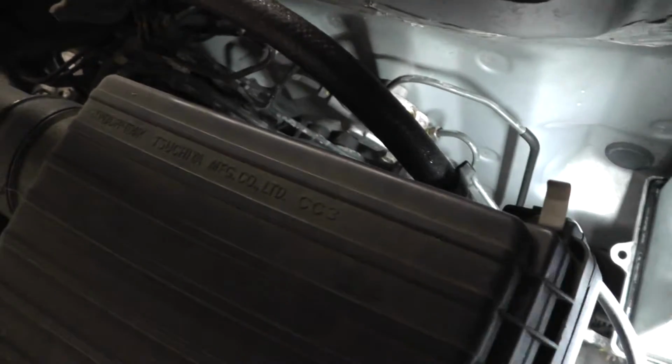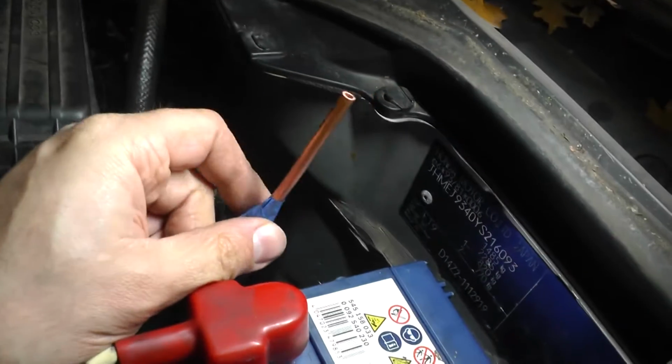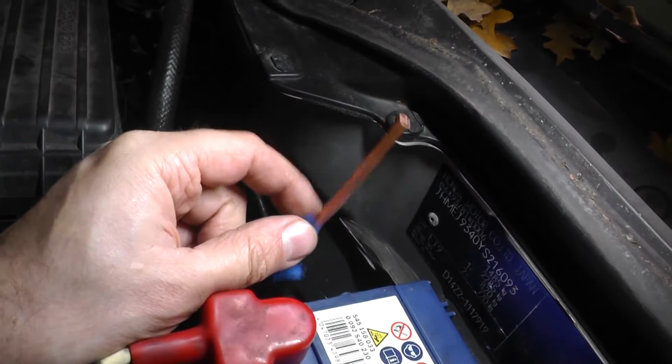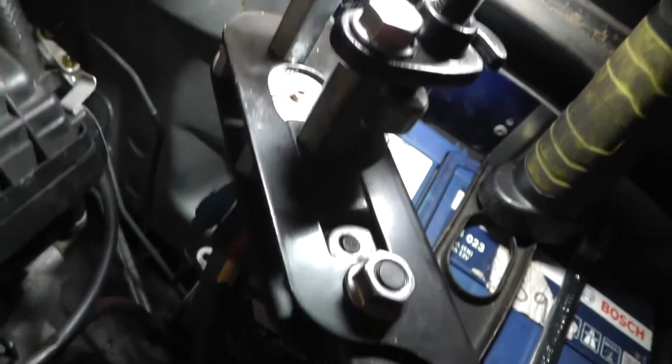Right, so I just went below the car. You can see I've just poked this brake line just up there. I'm going to try and get a kind of similar route. But beforehand, I'm going to put this little flare on. Top tip, just put the little connector on first and tape it in place so it doesn't slide down and you lose it. And then go ahead and put the nipple on. I've got the pipe just in here like that.